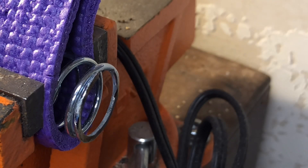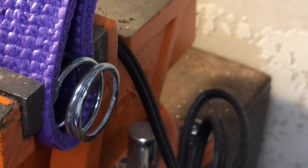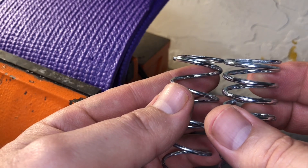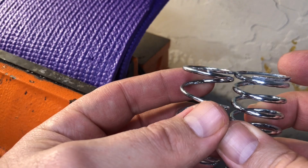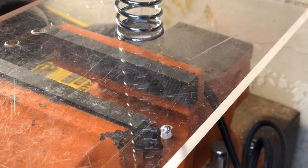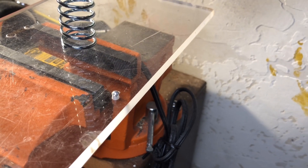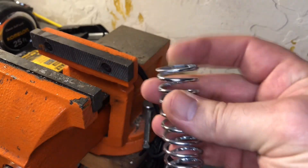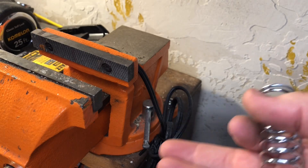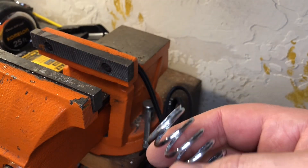The spring is not super hot on the other side, so I'm going to pull it out and take a close look at it. See how nice and flat that sits versus the wobble you get on the unmodified end. You'll end up doing that to both ends on all four shocks — a total of eight times — but as you can see, it takes like 30 to 45 seconds per spring to do it with this method.